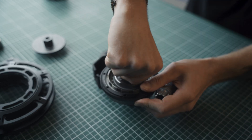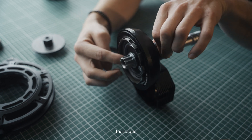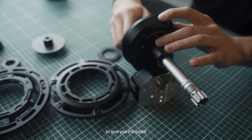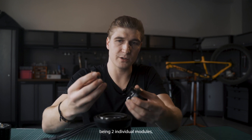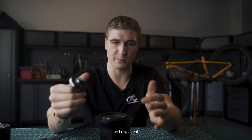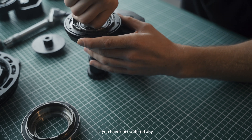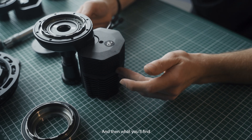Here is the unit spindle. As you drive, the torque reading goes through the module into the output stage and then into the chainring, where the motor drives with you to give you the pedal sensation you need. These are two individual modules, which is an advantage — if either fails or gives problems they are individually replaceable, meaning you can remove your current torque sensor and replace it, or unscrew the stationary module and change it, which should resolve torque sensor issues.